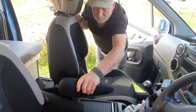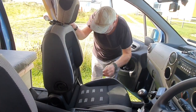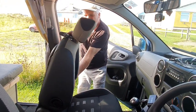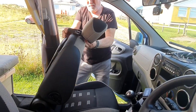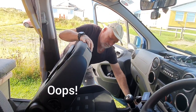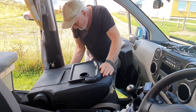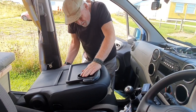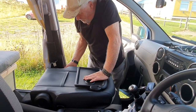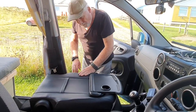The next thing we need to do is remove the armrests from the seats, so Bernie's doing the passenger seat first. Tilt your seat slightly forward so you can get the headrest off. Drop it fully down and put your body weight on it — keep hold of the clip, the adjuster, and put your weight on it and it will lock shut. Then you do exactly the same thing with the driver's seat.